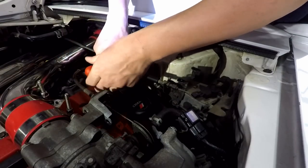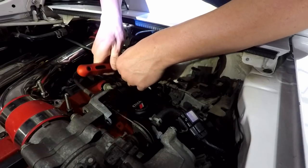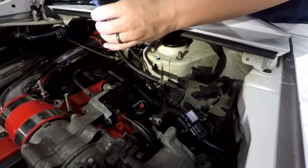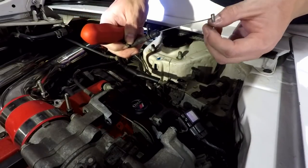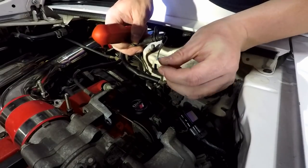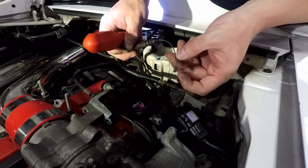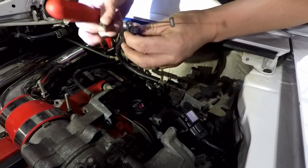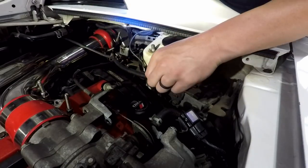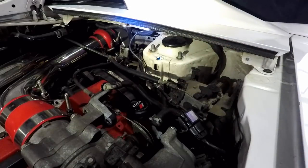Here's the Hux racing tool - this comes in such handy at these kinds of points. There it is, now it's being magnetic. Now this should slip up and out. Here you go guys - this is the little anvil piece I was talking about. What you do is it slips down in, and when it has tension it's pulling against this line. Once you pull against the mechanism that loses tension, this will slip up out. You literally just pull up on the cord and this pops out. This is where that was tightened up at. So once you do all that you're good to go. Three 10-millimeter bolts hold this in, and then your cruise control is out - then you just unplug it.